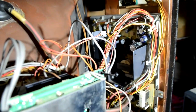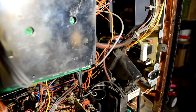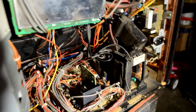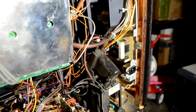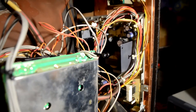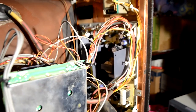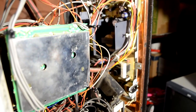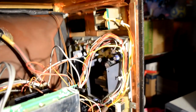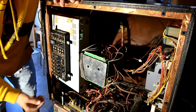When I turn it on, it has this terrible odor that smells like fish oil — like cooking rotten fish — which is a sign that most likely there's electrolytic fluid somewhere on the board and it's starting to heat up and stink. So really what we need to do is get in there and inspect that board if possible. I don't know how to get in there without ripping the whole monitor apart, but I guess it's time to finally get back in here and start doing some work.